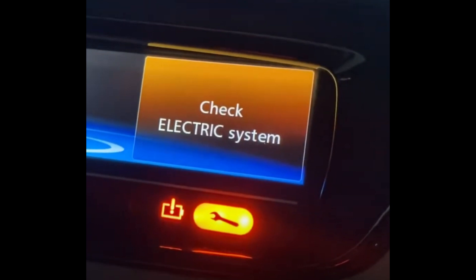You may be here because you have the 'Check Electric System' light on. It's happening maybe because you have a 12-volt battery issue — don't worry, this is only a small battery and you may have to replace it if it's more than four years old. Or it could be linked to the water pump. The water pump has an hour counter, and after 10,000 hours of working you get this light on. It means Renault recommends replacing it, but you don't have to.